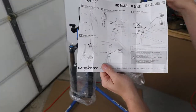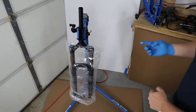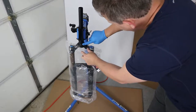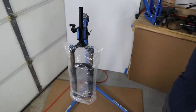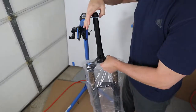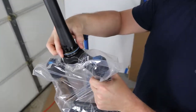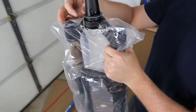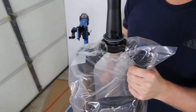Looking at the instructions, you can see the crown race at the bottom. It says apply grease to the steer tube of the fork before you set the crown race, and it specifically shows the layout — the chamfered edge goes up. So we're going to grease the steerer tube, set the crown race with the PVC pipe tool, then go back and remove all the excess grease. Grease attracts dirt, so the least amount you can use and still function properly is the right amount.